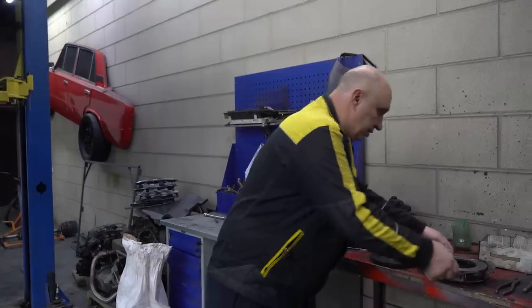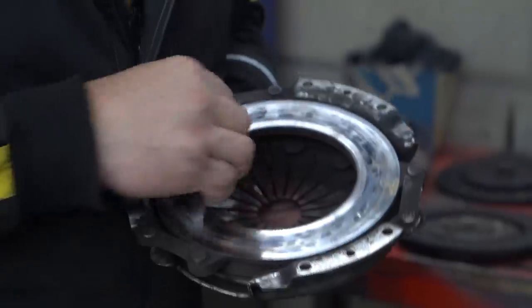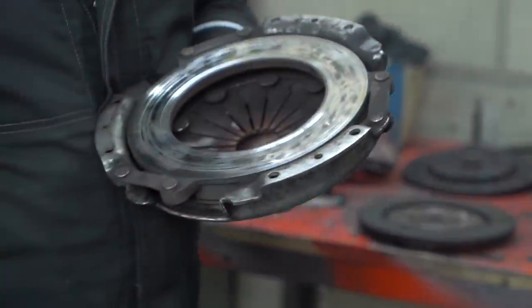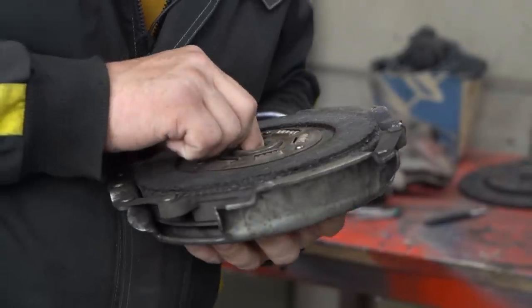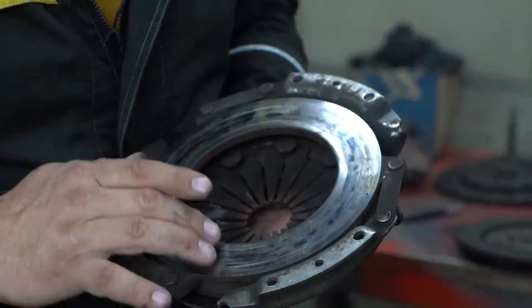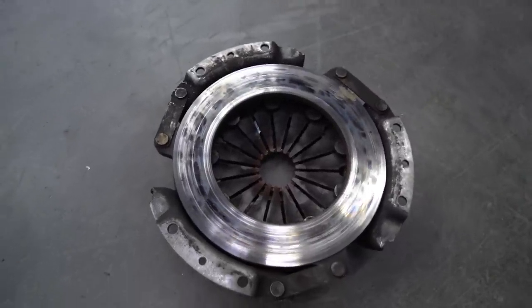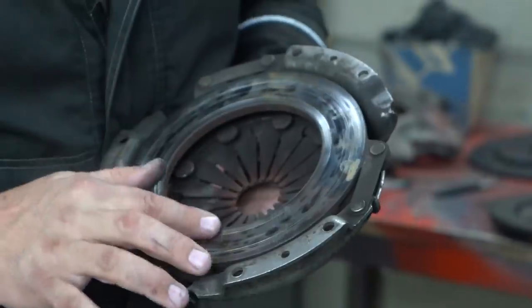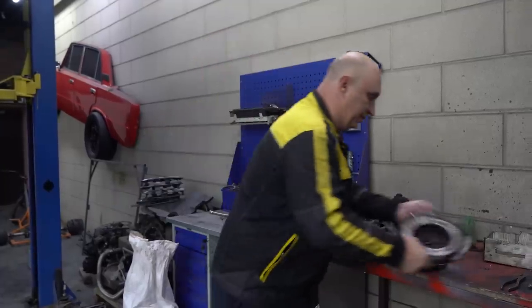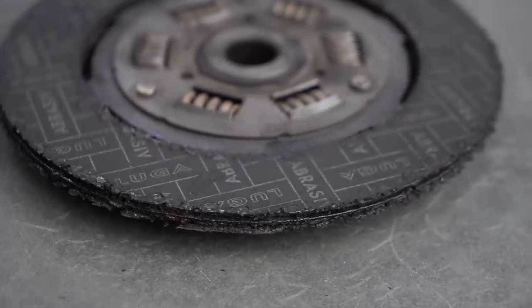Okay, moving along. Here we have the pressure plate. It looks about the same as the flywheel. The part where the material got expanded, you can tell that this edge has become super smooth, as if it were polished. In the middle, you still got those grooves that you can feel with your fingernail, but in these spots, the surface is very smooth. So at the end of the day, even without full contact, this worked fairly adequately.